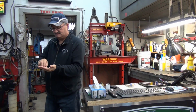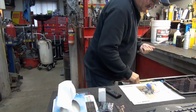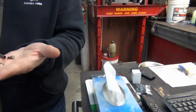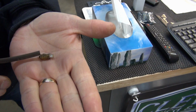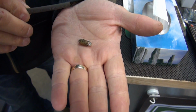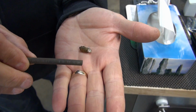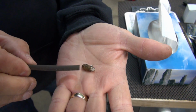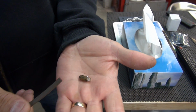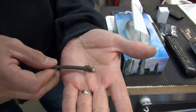So what I did, we'll use this as a pointer. This here is the LED light. I cracked the bulb off, and that's the old mount, and I gouged it out with a little bit of a drill bit. I took an LED, a light emitting diode, and I measured the resistance, and I stuffed the resistor down in here as well.